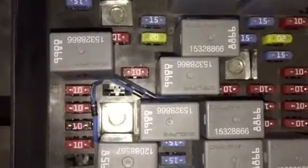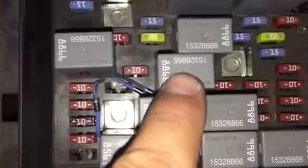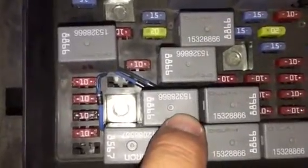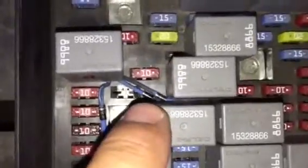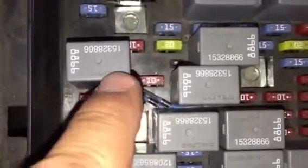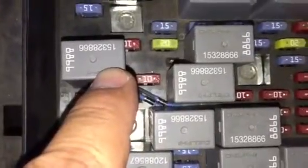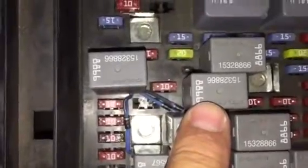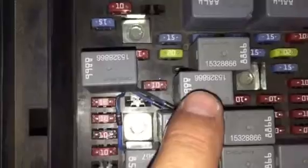I basically shrink-wrapped it so I didn't have any bare metal, so just the diode is showing. By wiring the DRL and the low beam with the gray stripe — as you can see on the diode — going toward the high beam, you're able to get all six of your lights on, meaning low beams and high beams.